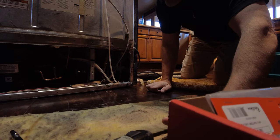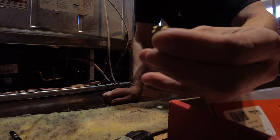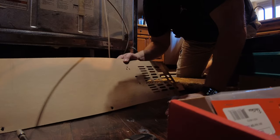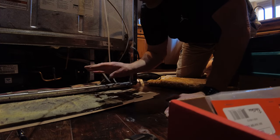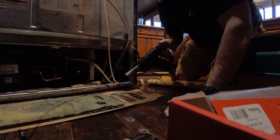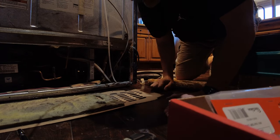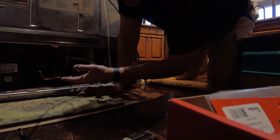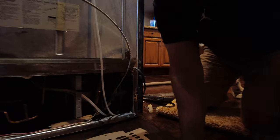I am looking at the bottom of the refrigerator right here. These are the screws that I took out, and this is the backing — it's a very cheap, flimsy backing, it's paper. You do want to save it because it does keep dust from filling this area in. This is a 17-year-old refrigerator. I suggest that when you open it up, you get a vacuum — definitely unplug it — and vacuum out the dust wherever you can see it. Try not to mess up any of these copper lines; don't bend those. But this is the area that we're focused on right here.